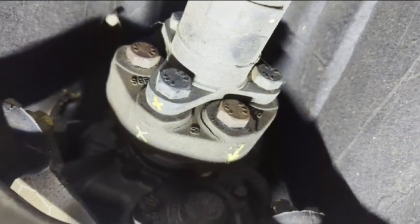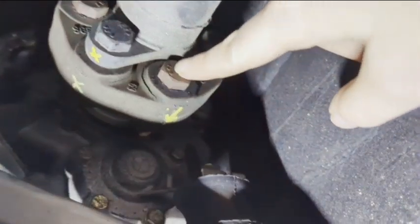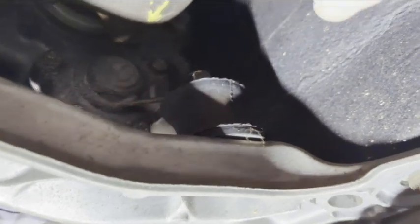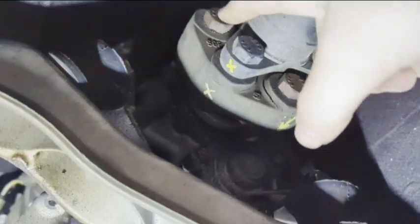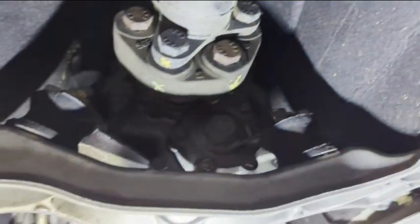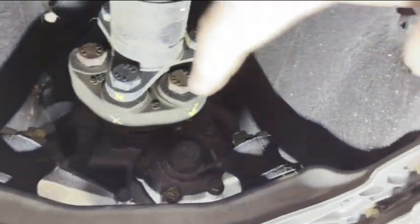Now, taking these off, these are 18 millimeter. It depends on what kind of maintenance you're looking to do. If you're looking to drop the entire drive shaft, you will just have to take the 3 out that are connecting the flex disc to the transmission, and then you can keep the flex disc attached to the drive shaft while you drop the drive shaft. Or if you're just going to do a repair, then you'll have to take all 6 of them out so you can take this out. There's going to be 6 of these bolts in here, and it's kind of hard to see, but there's going to be nuts behind here. So it gets a little tricky. Some models of the Z3 do have a balancer that you'll have to remove before you can access all this stuff. It doesn't look like I have a balancer on mine. That's going to be like a harmonic balancer that'll be right here. Mine doesn't have that, but if you have that, you'll have to carefully remove that balancer first.